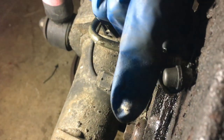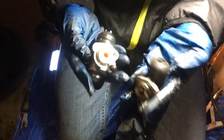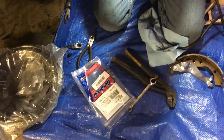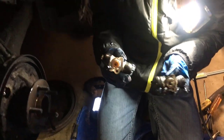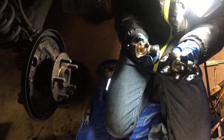You can see that there's a bleeder valve that you'll have to finagle out carefully. And there we go — this is the old unit. Here we have a comparison of the old and new part. Keep in mind that this new one is actually not genuine; it's aftermarket. It was around $12 to $13 at AutoZone. Also, keep in mind that the wheel cylinder is different for the passenger and the driver side of the car. This right now is the passenger side.